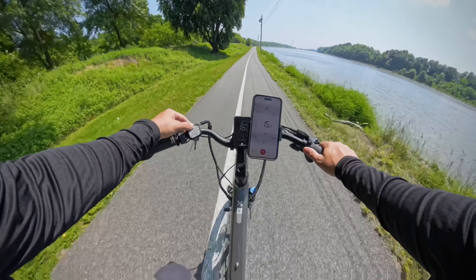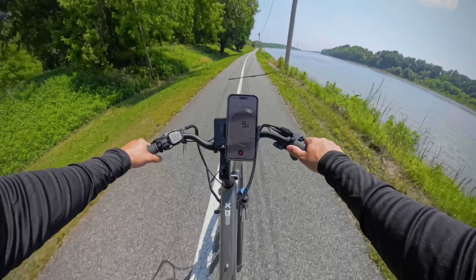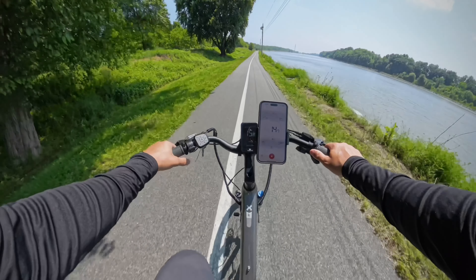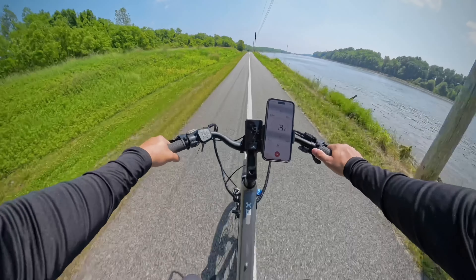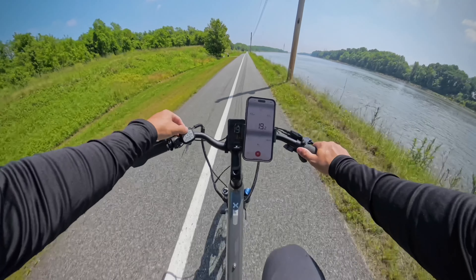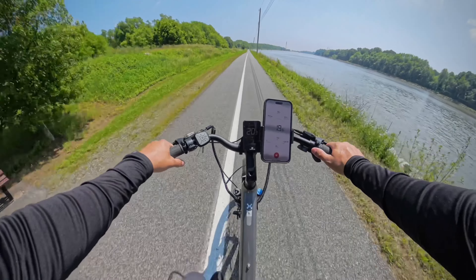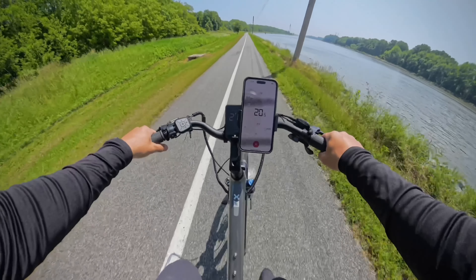Breaking down the top speed in pedal assist 1 through 5: I traveled a total distance of 1,462 feet with a max speed of 22.3 miles per hour and an average speed of 18 miles per hour in 57 seconds. Now, it being a 350 watt motor, that is impressive, but I did feel it was a bit lackluster because I felt that limiter right at the 20 mile an hour mark. I was pedaling hard through it but I felt it pushing back, and I could only reach 22.3 miles per hour without basically maxing out the gears. There are places in the EU that have regulations and limitations on bikes, and that's why this 350 watt motor is only capable of this top speed — and these regulations are going to be coming to the US. I have some videos in the description for more information about legislation and regulations for electric bikes.